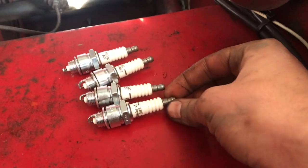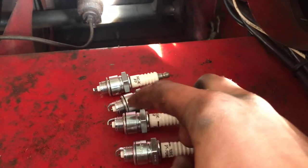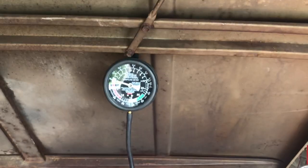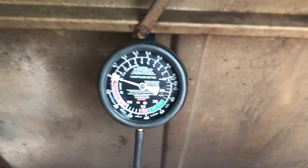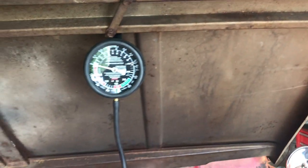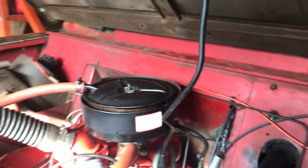I have my new set of four spark plugs — these are correct for my engine. What I'm going to do before I install these is put a little anti-seize on, but I'm going to do it after I run it so it'll utilize the fresh plugs right away rather than go through rich-lean cycles. I like to replace them since I don't know how many miles have been put on these plugs. I'm going to grab a flathead screwdriver to adjust my air fuel ratio. This is a Holley 1904 carburetor, just a single barrel.